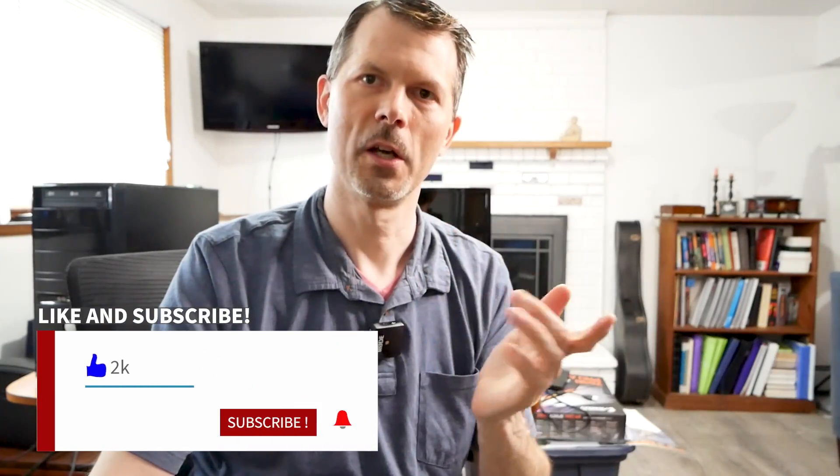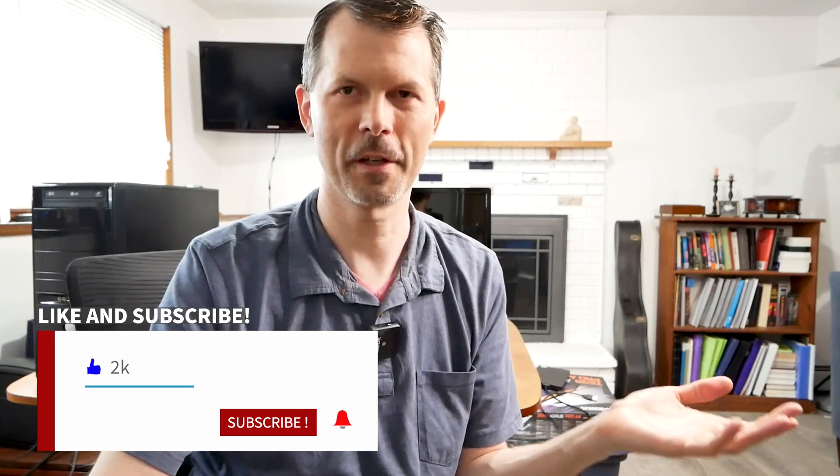Hey everyone, welcome back. Everybody knows that CPUs for your PC need thermal paste to transfer heat efficiently from the hot CPU to your cooler and heatsink. Well, what about your GPU? Today I'm going to be taking apart my 8800 GTS video card. This card's temperatures are idling around 64 Celsius at idle, and under load playing games under Windows Vista it's getting into the high 80s sometimes, which probably isn't that good.